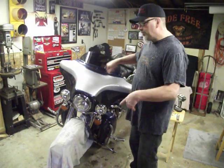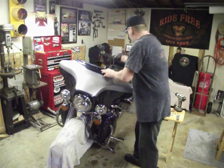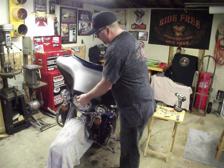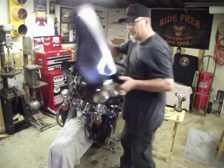To save some time, I've already removed these screws, but there's three here so that the windshield can come out. There's a screw here, one between the forks, same on the other side. Lift the fairing cover up a little, unplug the headlight, and the cover is loose.